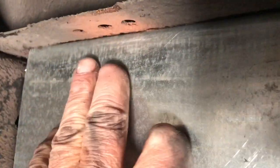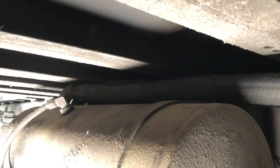Okay, guys, so here I am at the front of the under bay, just on the side of the C-frame. And I just went and got the old hose just to test fit it. And yeah, it'll tuck right up in there. And it won't really be in contact with the air tank. But the cool thing is, in the summertime when this would get hot, I got two valves back there that I can shut off, and this hose just sits then idle. So it's plugged off and it can't move the hot water up here.